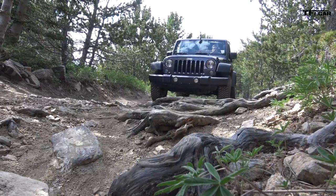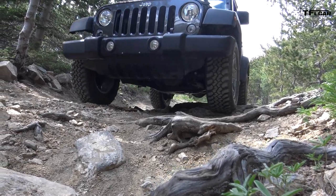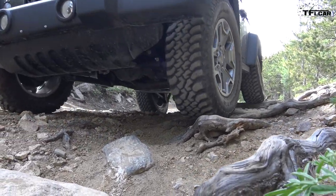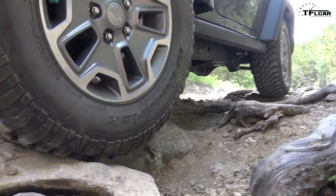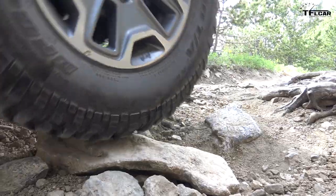What makes the BFGs better than the Goodyear Wrangler SRAs: first, you have big knobbies to claw at the dirt, the mud, the rocks. Second, sidewall protection — this is a big thing when you're off-road. Pointy rocks, especially with a road tire, can easily puncture the sidewall; that's going to be less of a concern with these tires. Next is the compound — this is an off-road compound that provides better grip off-road. Recently I had the opportunity to go up the cliffhanger with some buddies, so check out that video.